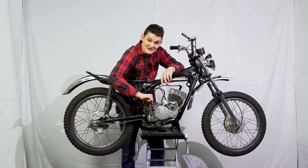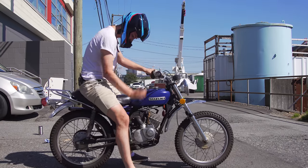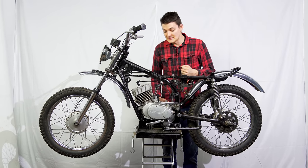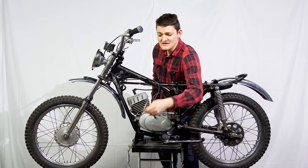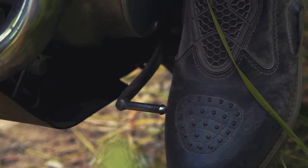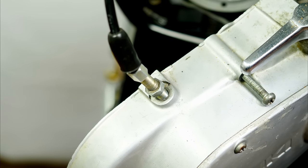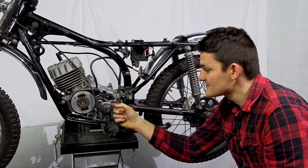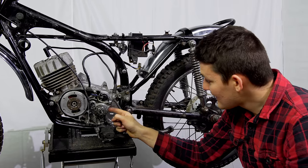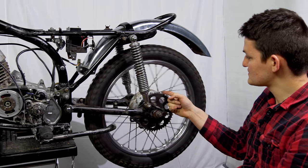It's mainly the spinny stuff we care to oil, and to get things spinning, you kick this — the kickstarter. Whichever part of the transmission shaft you engage, it spins a counter shaft, which is why we call this the counter sprocket. That, in turn, turns a chain, which turns the rear sprocket, which turns the rear wheel.